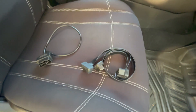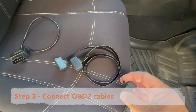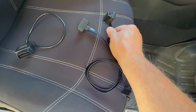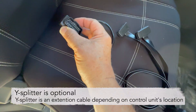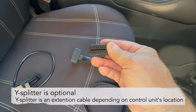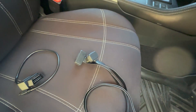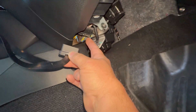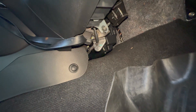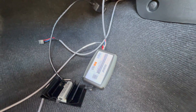Installing the OBD2 cables. The kit comes with a Y-splitter cable that goes onto the vehicle's OBD2 connector and has two parallel outputs. One goes to the lock-up kit and the other is free to use for an OBD2 reader like an UltraGauge or ScanGauge. It plugs onto the OBD2 connector just like that, and that gives the lock-up kit both power and data communications to the vehicle ECUs. Now the final step is just to plug all the cables in.